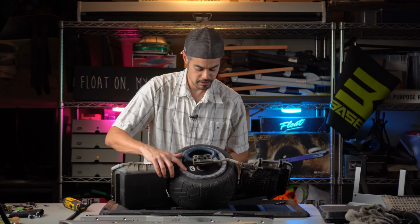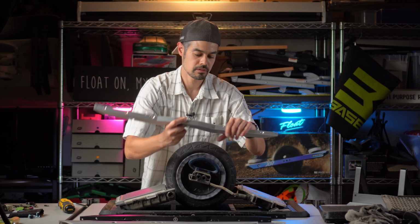On the inside of this rail is the Float Life's motor plug retention cable. This cable right here goes to the motor and can potentially pop out or break off, or if you've overtightened this, you might have broken the little plastic tabs and it doesn't stay in place very well. So having a motor retention cable helps hold it in place, and we need to transfer that over to the new ones. So let's take that off of there and move that now so we don't forget.